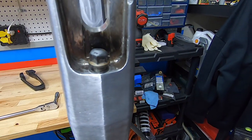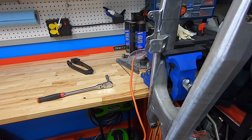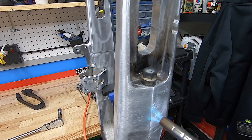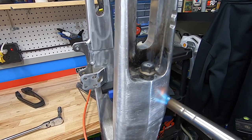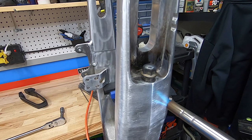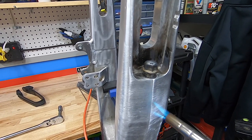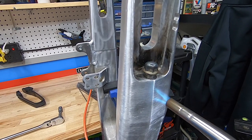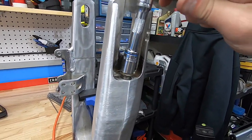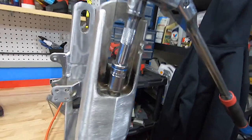We're back in the garage. I'm gonna throw some heat on this thing and see if maybe just maybe this is gonna back out. I have my feelings that it's not. Hopefully the aluminum gets hot enough that it expands much faster than the bolt, so that we can get this thing turned a little bit. My goal here is to get this so that it will turn inward and not out, so I can get some more penetrating oil in there. If it doesn't work this time, we're cutting this thing off and we're gonna put the fix-it kit in it. Moment of truth — I'm gonna try to do this while holding the GoPro, so hopefully my vice holds up.